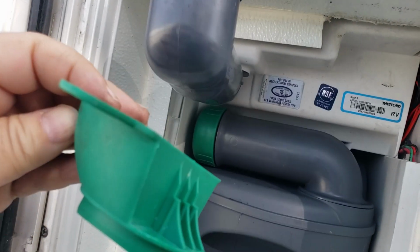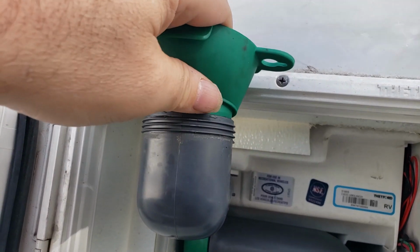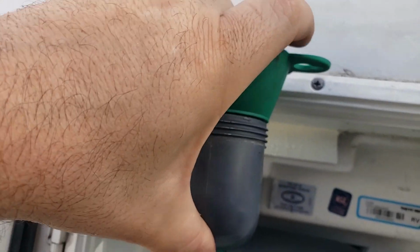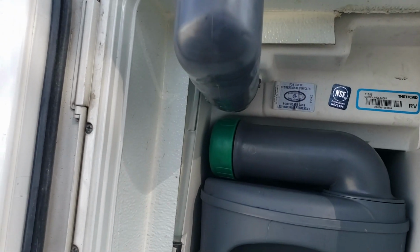I'm always going to put this on. So let me tell you, when you're filling this water using a hose, unless it's on a trickle, very slow mode, it isn't good. You really want to fill it from a gallon bottle of water. This can take about 5 gallons if it's completely empty. Put that on there so the flat side is facing the truck.